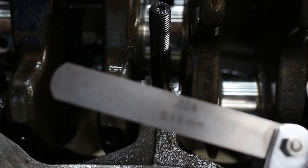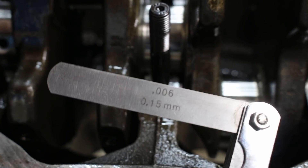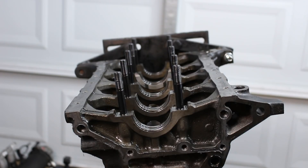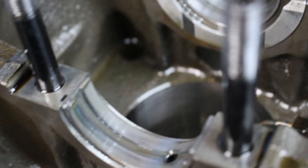I'm really looking to see how much the rear one has worn, because that's the one that takes all the abuse when you put your foot on the clutch pedal. And there is your answer — six thousandths of thrust clearance, which means these bearings have approximately zero wear. Now you can remove the crankshaft — be very careful, especially if you still have the main studs in your block, because you do not want to scratch the journals on the crankshaft. This essentially completes the teardown, but I did find something interesting with the front main bearings after removing the crankshaft.